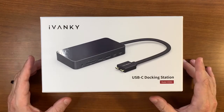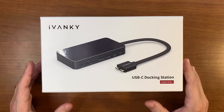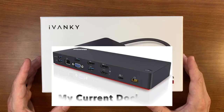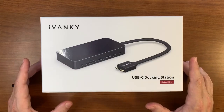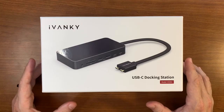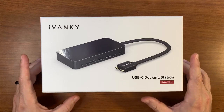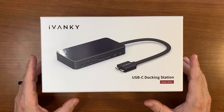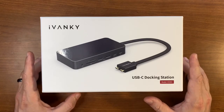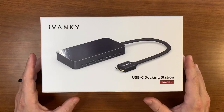Most USB-C docks you'll find on the market offer the ability to output to multiple monitors — in fact, going as far as having multiple DisplayPorts on them. But due to the lack of multi-stream support, if more than one external monitor is plugged into a USB-C docking station like the Lenovo one I'm using, the screens will actually be mirrored and not viewed by macOS as individual monitors. I'm currently overcoming this by using an additional Thunderbolt port to drive a separate second external monitor, but that adds additional wires and cables to my setup, making things extra complicated.